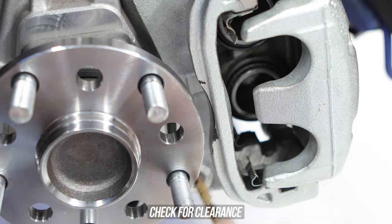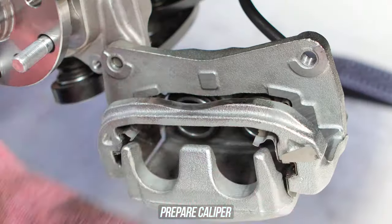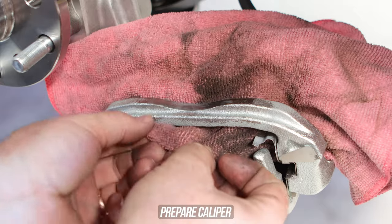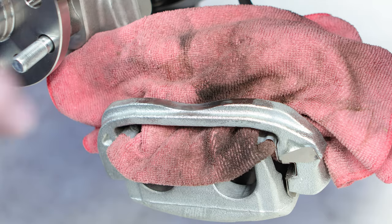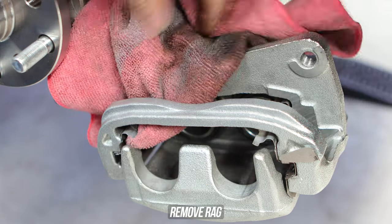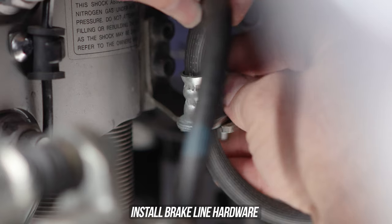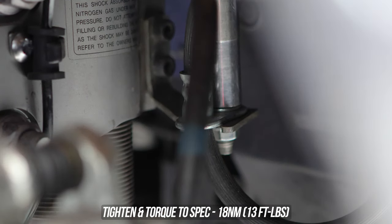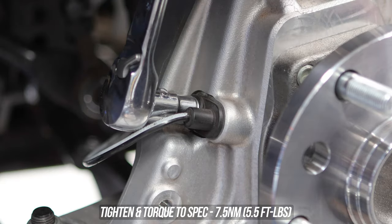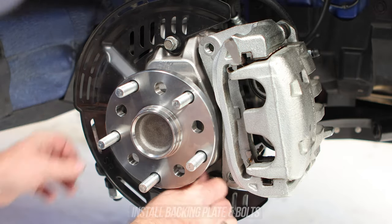We can't go to cars and coffee with grind marks on our calipers, so loosen the caliper bolts and remove the top one, letting the caliper dangle. Get your favorite microfiber cloth to protect the inside of the caliper and spray it with the exact same color as the caliper itself — and not hot pink like you really want to. Remove the rag, give the caliper a blowout with compressed air just in case of any metal or paint debris, and you're all set. Flip the caliper back up and put the top bolt in temporarily while reinstalling the surrounding gear. Put the brake line back in its bracket, torque to specs, reinstall the sensor bolt to specs, and put the backing plate back on with its three bolts torqued to specs.